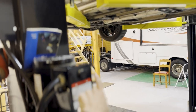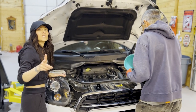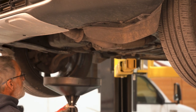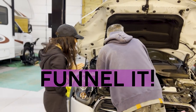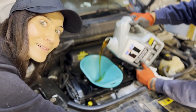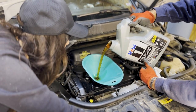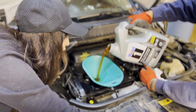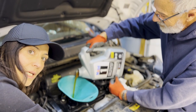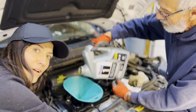It was pretty fun to pull that lever. Once you've got all that oil drained out, it's time to grab another funnel and pour your vehicle-grade oil in. The Mini Cooper Countryman All 4S takes 4.4 quarts of oil.